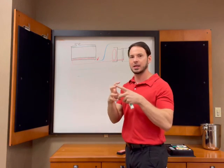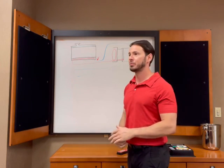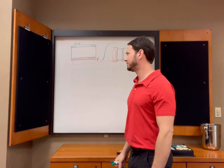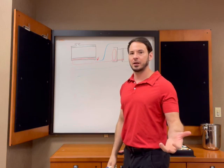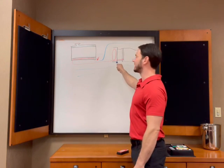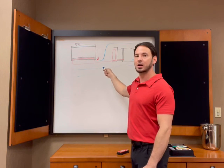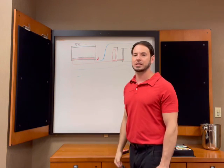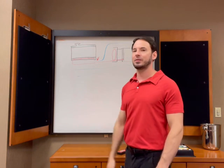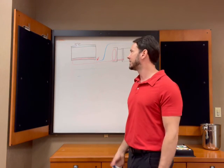You take it apart and the gears are basically welded together because the fluid aerated and totally destroyed the thing. Again, how did we get the transmission that hot? It's because we're constantly shearing that fluid, trying to push the car down the road. The SVX is just not gonna do that. I've driven an SVX all over the country. I've driven it up some of the steepest hills out there.